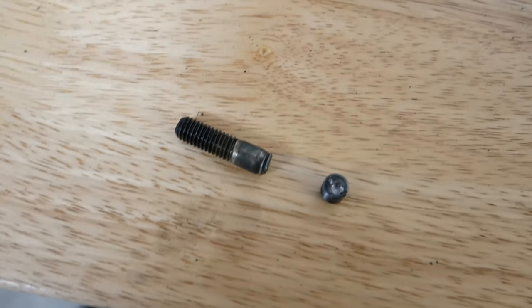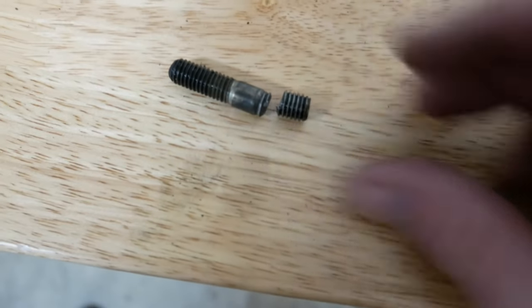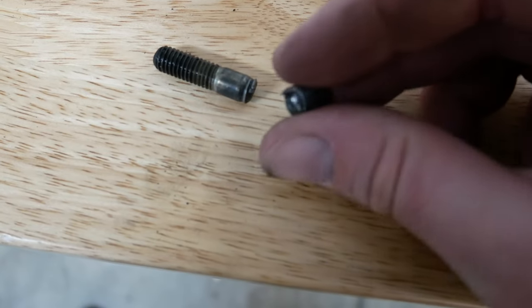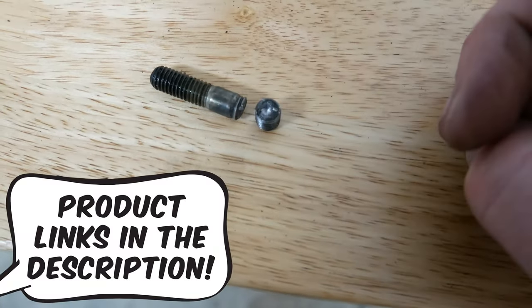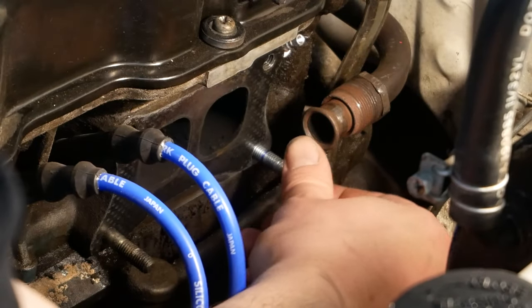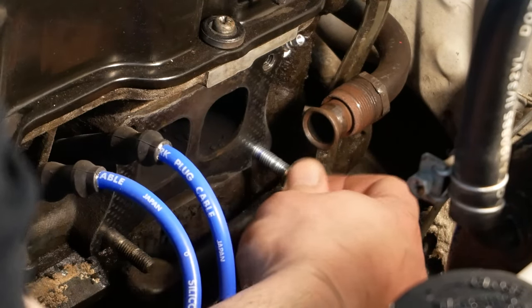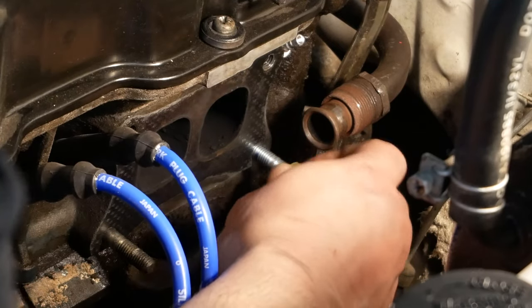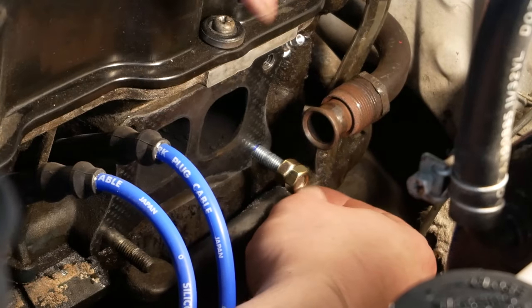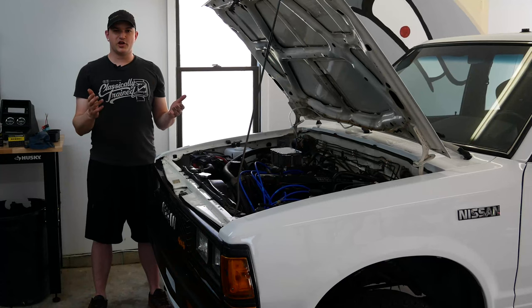Here you can see we have both sides of the bolt — the part that was stuck in the engine wasn't very deep, but we wanted to get it out so we could get the replacement bolt in. I'll leave links in the description to this bolt kit if you have a Nissan 720, but make sure you get the correct bolt for your engine block. To put the bolt back in, I measured it first, put a little mark on it with blue Sharpie so I knew exactly how far depth-wise I wanted it, put a couple of nuts on the end, tightened them together for a good hold, and got it back in the engine block so we can continue with the header install.